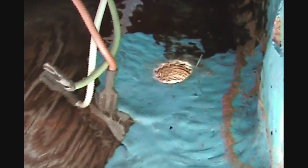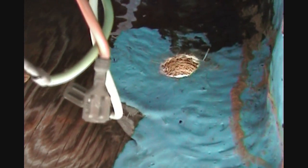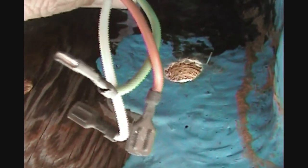This is the underside of the dash console. You can see here the back side of where the horn and the light switch go. This is the harness for the lights. Red is power, and the green is the front navigational light for port and starboard, and the white is for the rear light. That's kind of a see-all light. It's supposed to be like 225 degrees visible.